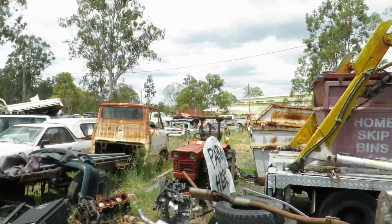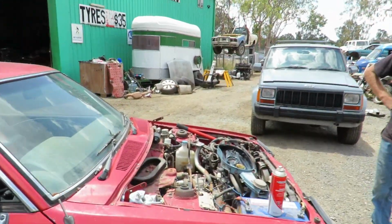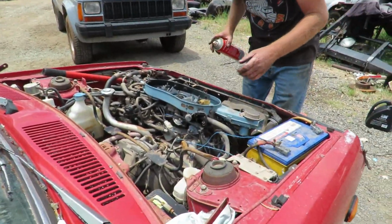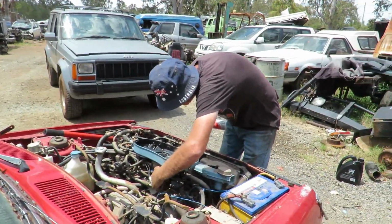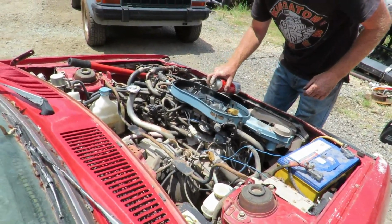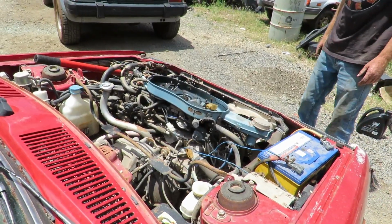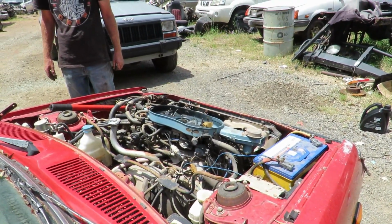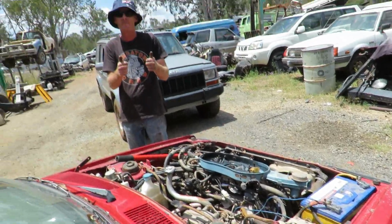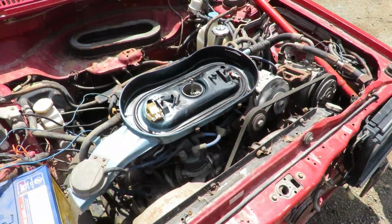Right, I just got back. He's got the car out now. Okay, so it's in the driveway, not over there in amongst the cars. He's unbolted the exhaust, so it shouldn't be blocked. So in theory, we should be able to. Can we do throttle? Hang on. It looks like the venturis are wet, so it looks like the fuel's come up to there, but we'll just. Yeah, so the exhaust was blocked. There you go. To me it doesn't sound like it's done a big end. There's no big rattles.